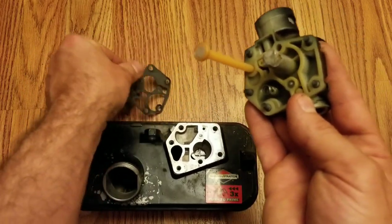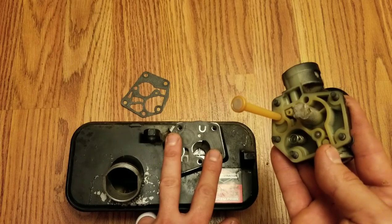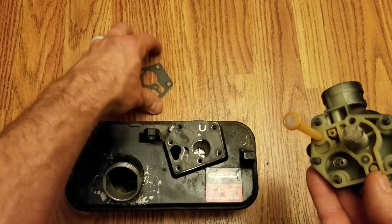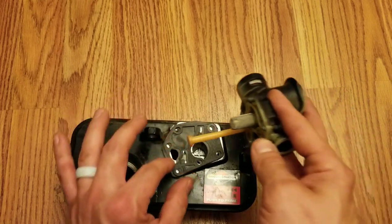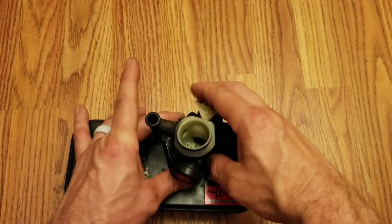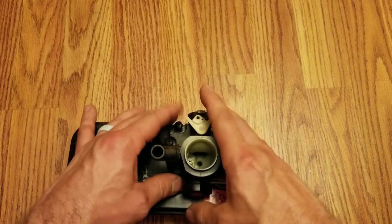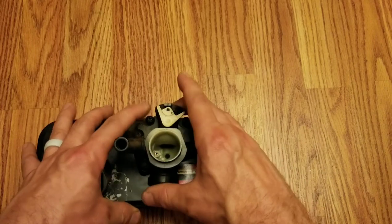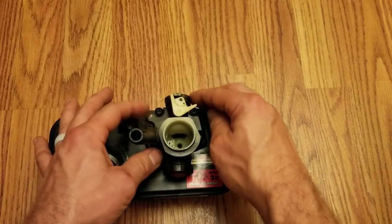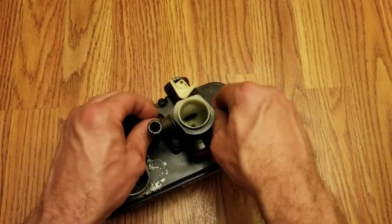I'm going to set up my diaphragm and gasket. Diaphragm goes down first towards the face of this gas tank. You want to make sure that it follows that pattern on the face here. Put the gasket on top of that — all this stuff has to line up real good for there to be a seal. It works kind of like a squirt gun and has to be sealed up properly. I have all my screws still inside my carburetor as I'm lowering it down, giving it a little shake and coaxing the screws to go into the holes without piercing through the diaphragm. Be real gentle with it — any extra holes that aren't supposed to be in there and it won't run.